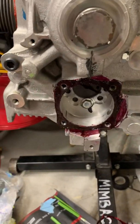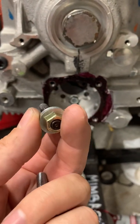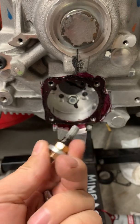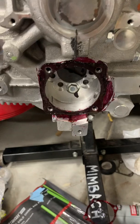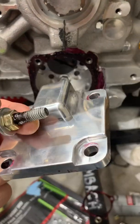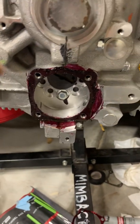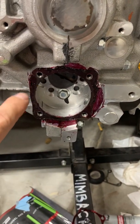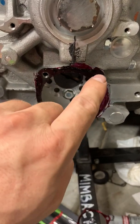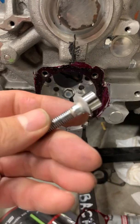I got the studs out — I just put a nut on here and a washer and took a wrench and backed it off. The problem I was having is these studs wouldn't reach through my full flow cover, so I couldn't put a nut on. They were just sticking through the cover with just a few threads, so I had to take everything back apart, take the studs out, put some penetrating oil on there, put the bolt in, and cleaned out the threads.